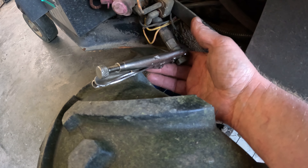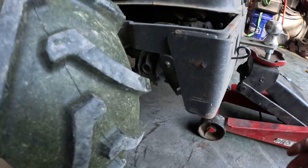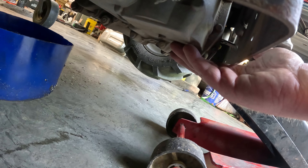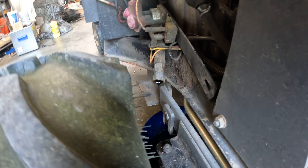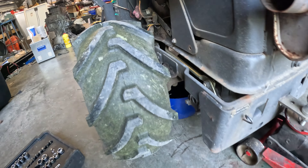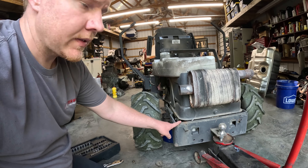I've already gotten most of the grass and stuff blown off of it. I will need to pressure wash this thing because it's quite filthy. First up, we're going to get the deck off. This here is the drive blade or drive belt release lever for the deck. Push it over, belt gets loose, then you can pop the belt off the pulleys, and the deck will slide forward once it's lifted off of this bracket down here.